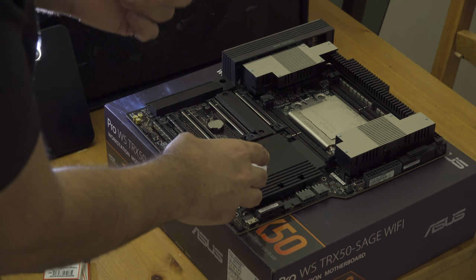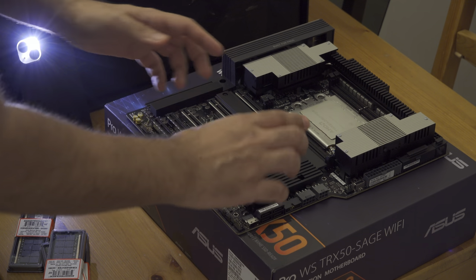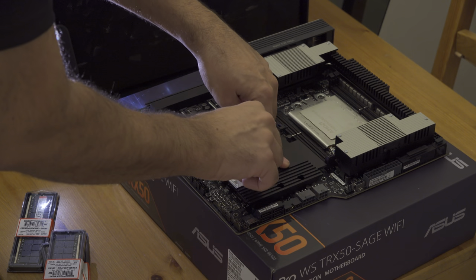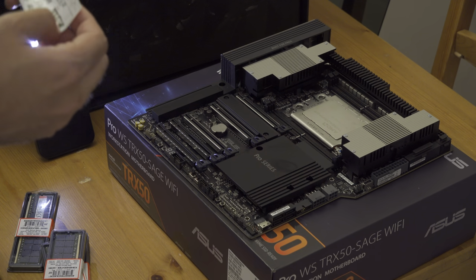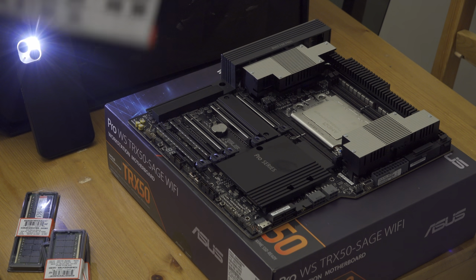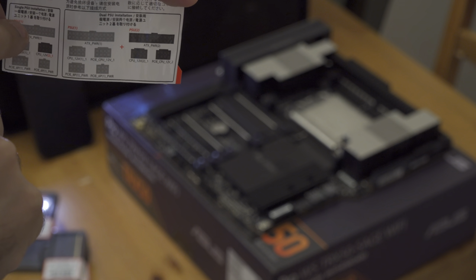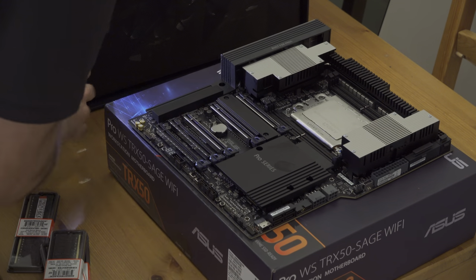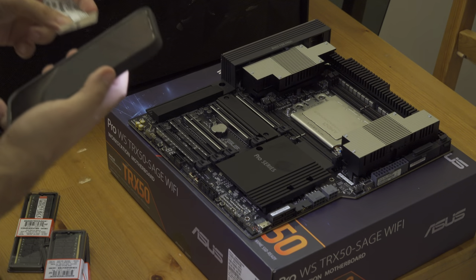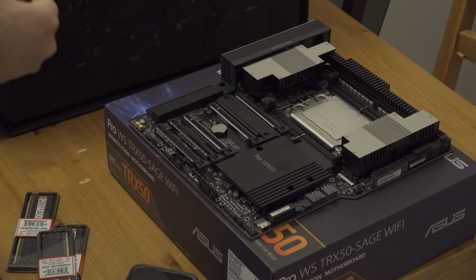Let's look at this sticker — it shows PSU one and PSU two for dual PSU configuration. I'm going with single PSU. Let's go ahead and mount the RAM first. These are RDIMMs — I've seen people accidentally ordering regular DDR5 instead of RDIMMs or registered buffered DIMMs. Always check the motherboard's qualified memory list. I found these on Newegg and they were on sale for Black Friday — decent enough sale so I pulled the trigger. They're not the fastest but they'll do the trick.